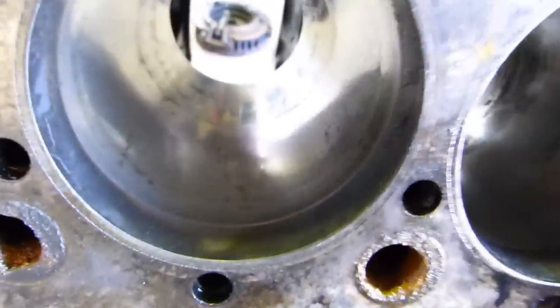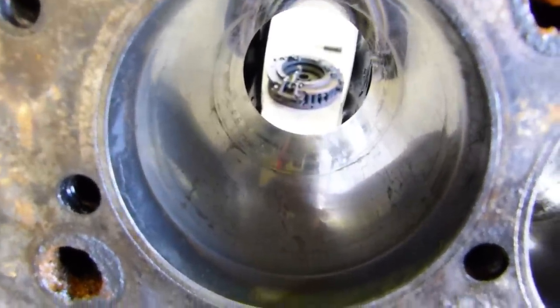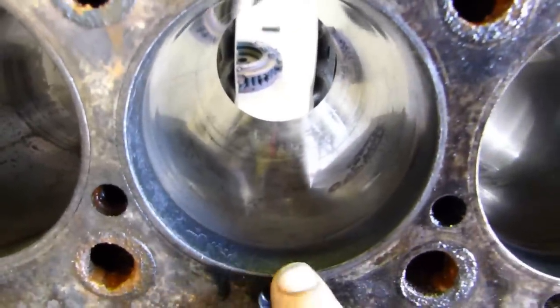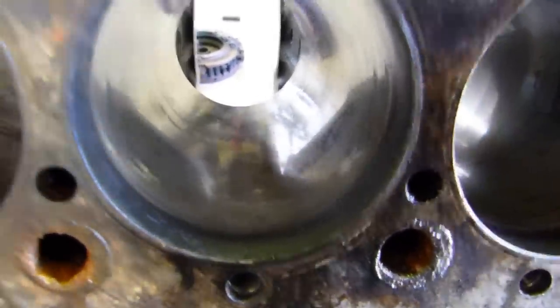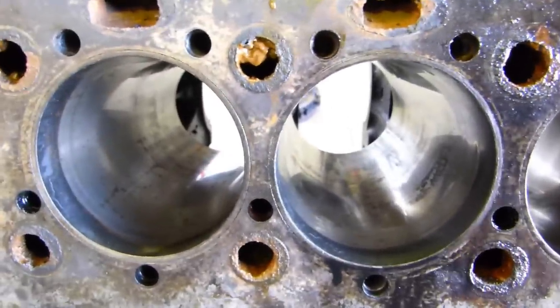So I'm not going to muck around measuring the bore. It's just buggered. So what that brings us to next is pulling these liners out. They're a dry sleeve, and we can run a weld down and shrink the liner out. So we might go and get the welder set up and have a bit of a crack at that, eh?